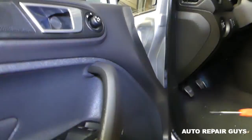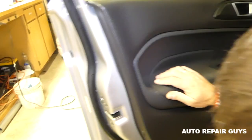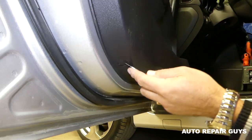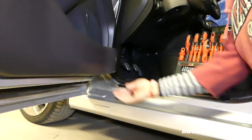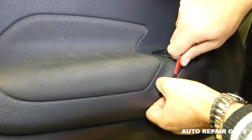If you open the door handle, there is a place where you can pry that cap open — just be careful not to break it. It is just like this one right here; you pull them out like that. That's how it's supposed to be. We have one more on the bottom right here. Use the door panel removal tool for the cap on the door handle — that way you don't scratch the trim.